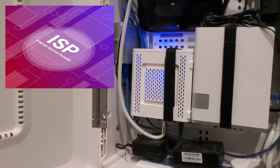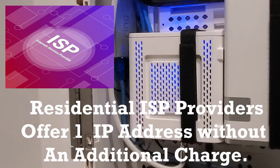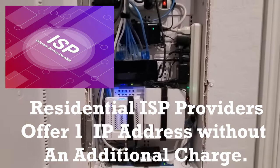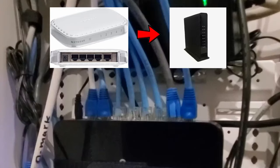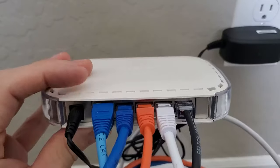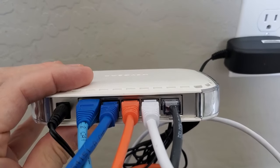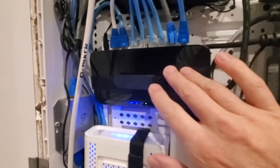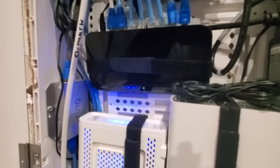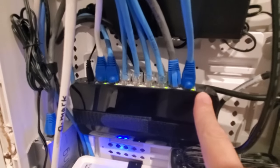Let's start with your ISP, Internet Service Provider. Most residential ISPs only offer a single IP address for its customers. So when you connect a switch to the cable modem, each device attempts to get an IP address directly from your ISP. If you have a 5-port or 8-port switch plugged into your modem, then only one device will get that ISP address. The other devices on the other ports will not have internet. So if you want all your devices connected to your switch to get internet connectivity, this configuration will not work. The only way to get all your ports on your switch to connect to the internet is to place your router in between your modem and your switch.